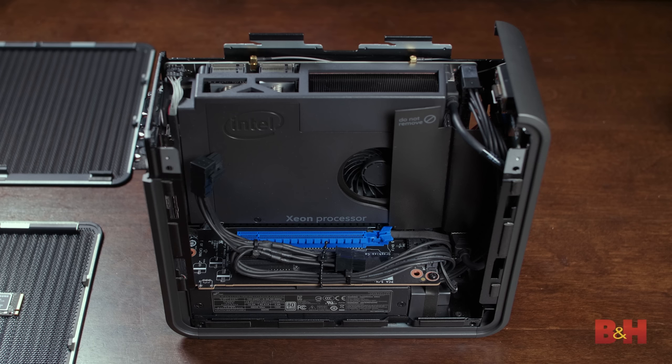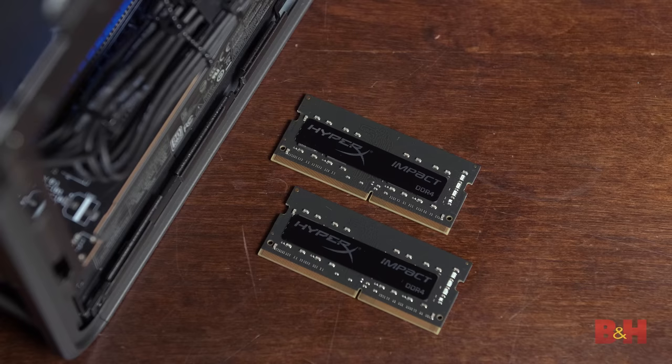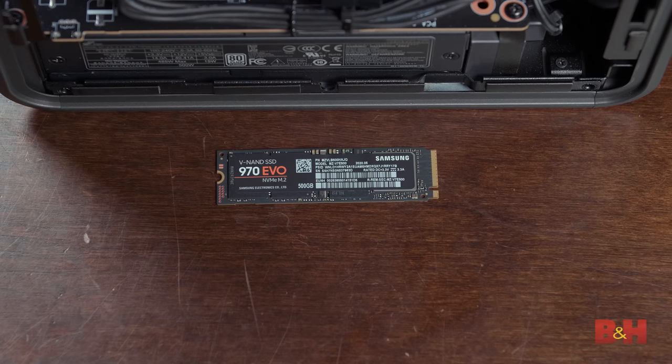And there it is. The compute module, as you can see, is a full CPU, motherboard, heatsink, and fan in one swappable card. It kind of looks like a graphics card. We don't need to take this out at all, but we do have to add a few things. I'll be adding 16 gigabytes of DDR4 RAM. You'll notice I'm using laptop-style SODIMMs, which are required for the small form factor here. For storage, I'm using a Samsung 970 EVO 500 gigabyte NVMe drive,